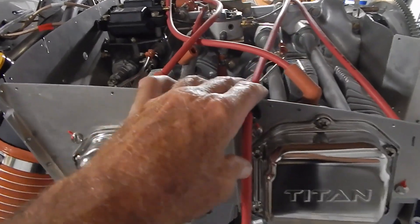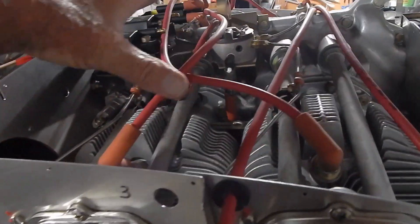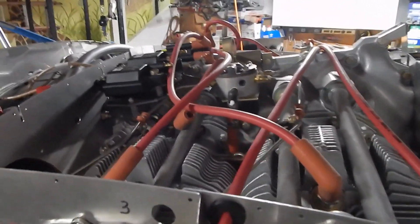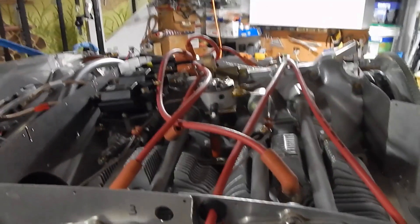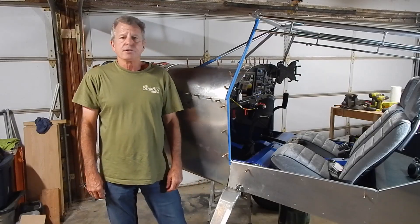These two coils sparked at top dead center so those are cylinders one and two, and the others will be three and four. Then comes the fun exercise of matching the ignition wire lengths to the correct coils — you've got short, medium, long, and extra-long wires. The extra-longs have to run from the bottom cylinders all the way up through to the back coil. When I first had them in they weren't matched correctly, so now I have to undo the little grommets and sort out the short ones from the long ones — it's like a Rubik's cube of ignition wires.